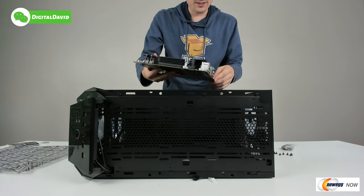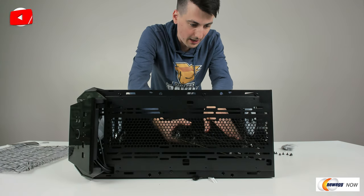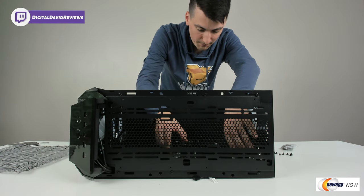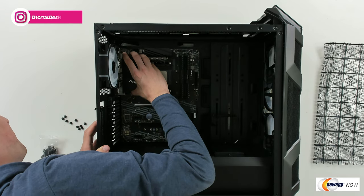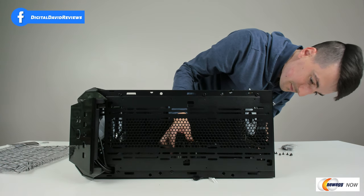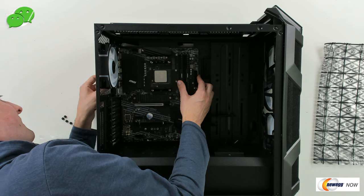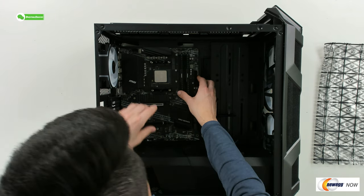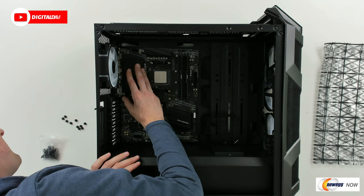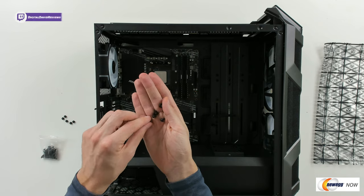With that being said, now we're ready to place our motherboard into the case. At this step, if you have an I/O shield like I do that's already installed on the back, you want to make sure that none of the grounding options accidentally block any of the ports as you place it in. So just be very careful with that. Double check after you place the motherboard in that you're happy with everything. In my case I can see I'm not — I got to get underneath that guy right there. Now I'm looking back, none of my USB ports are blocked or covered. Same with my HDMI and DisplayPort. Everything is set up here and it looks great. So we just need to make sure now that it's just lined up with the holes. We have it dropped in place. And now we're ready to use the included screws that came with our case. Maybe you have screws with your motherboard too.